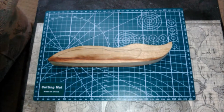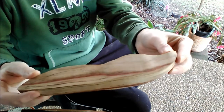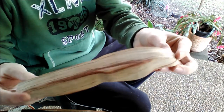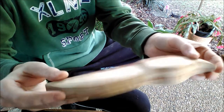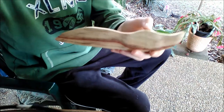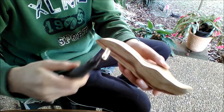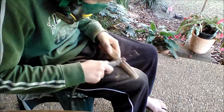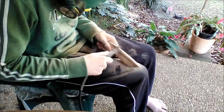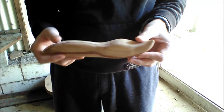The phone's all charged up now. What I've done is I've just sort of shaped this up a little bit, rounded out the rough shape, and I've got a few sort of bevel lines drawn on there which you can't really see. Now the next step is to get a little sanding drum on the end of the rotary tool and we're going to sand in our little bevels.